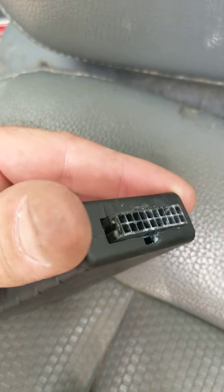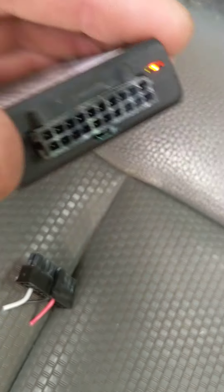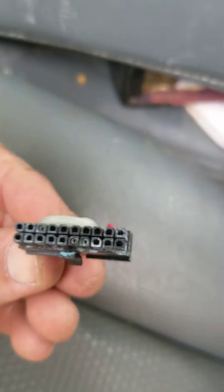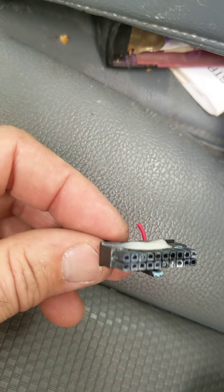You can see how there's corrosion in there, and the pin on the ignition is corroded. You can see right there where the white wire goes in — it's pretty corroded in there, and you see the green stuff in there. That's why it wasn't reporting ignition.